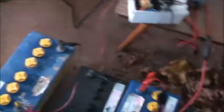What I'm doing now, charging them again, is to just clean off any excess sulphate off the plates — what's left of them after they've been sitting for a while. I'll get as much of the sulphate off the plates as I can, then we can do the conversion. I'll keep them maintained just to keep the remaining plates clean.